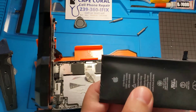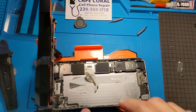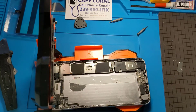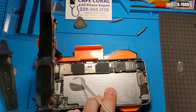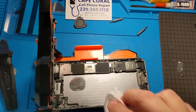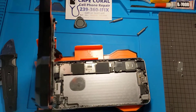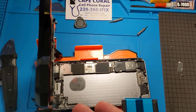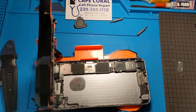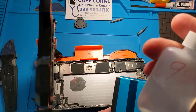There's your battery — you want it to come out as thin as possible so you don't cause any damage. The thinner it comes out, the better. Use lots of patience; it may test your patience, but you want to do it the right way. Then take out the remaining adhesive tape, clean it up, and get the new battery in. As you can see, we didn't have to remove the screen. The strips didn't come out nicely like we wanted, but there is a plan B — you just need the right tools and 99% alcohol, since it evaporates super quickly.